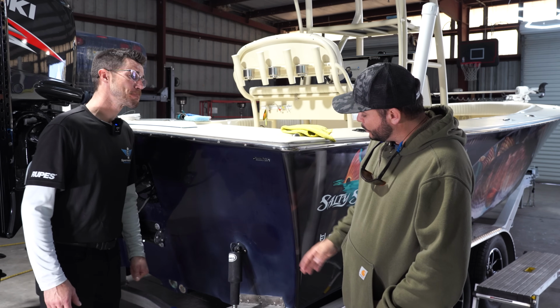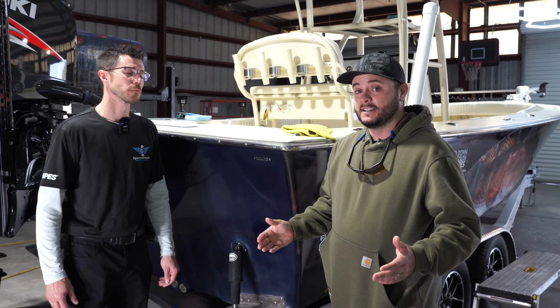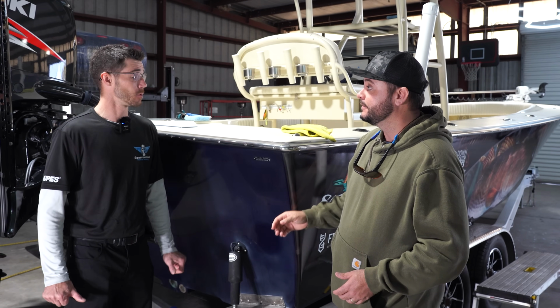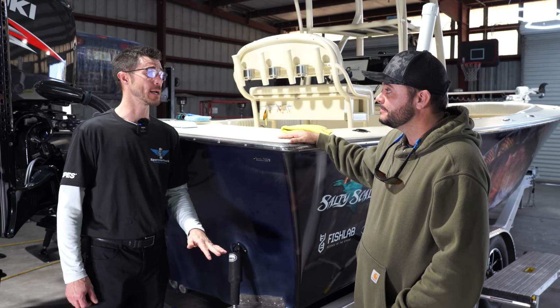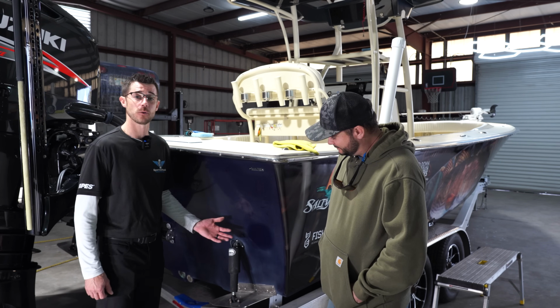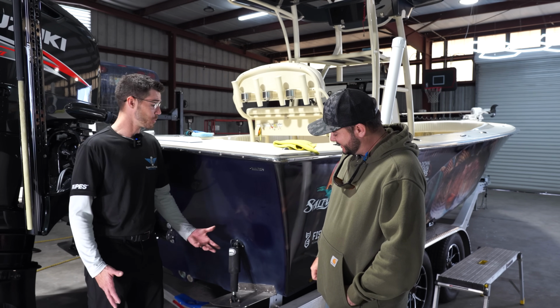Okay, so one of the things that, like you say chalky, so you may need a few additional steps if your gel coat's worse. Sure, absolutely. So if you touch it with your hand and you see white chalky oxidation residue, you're going to need to take your sandpaper way down, 400, 600, 800, and work your way up from there. Thankfully, we don't need to do this in this situation, which helps me quite a bit. Right. And it gives you a nicer finish.